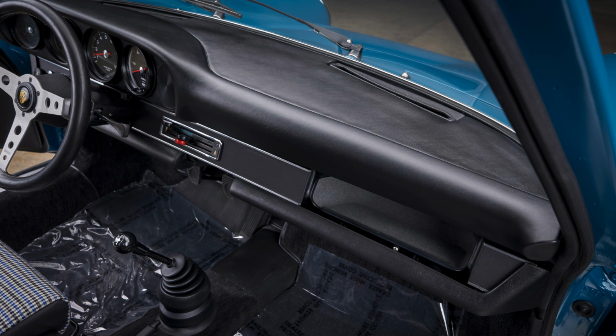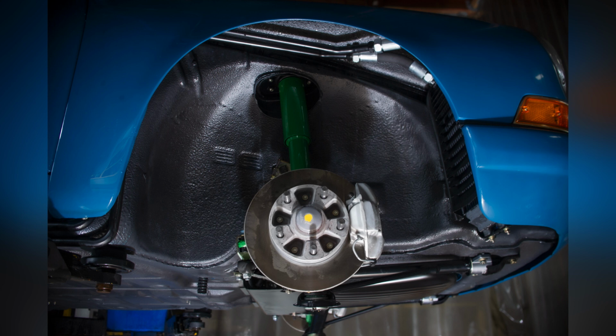Brand new SSIs. That's why the heat is so good. The oil cooling system: you've got a Carrera wide mouth cooler up here. I custom make the brackets to fit them and everything. It does have an electric fan on it, which is super cool. If you're sitting in traffic, when do you need air? Sitting in traffic on a hot day, that fan will turn on at 195 degrees. I put a lower temp sensor in there, and that is wired in, obviously, to the front trunk over to the panel there.